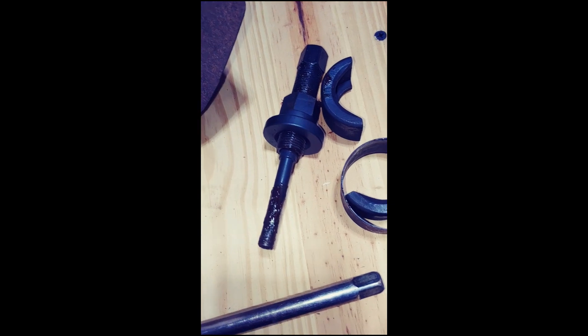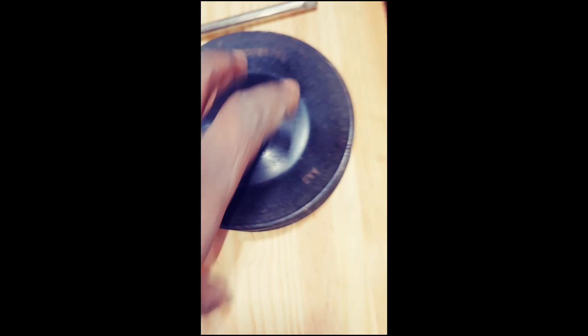Get your power steering pulley remover on there and get her off. You got to get on top of the vehicle for some of it and on the bottom for the rest. There are three 13 millimeters that attach the pulley to the assembly.